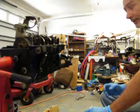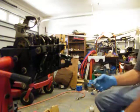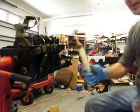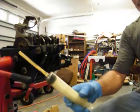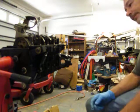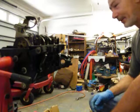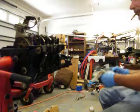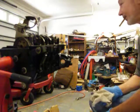That helps get all those little crosshatch marks oiled up, and then my rings have oil on them. When I get ready to put the head on, I'll just suck all the oil out with this nifty little tool right here — it works great. I used to use that to put oil in the generator, believe it or not. It's a lot easier than trying to put a funnel on one of those things without flooding it. Pull the oil out — virtually impossible otherwise.